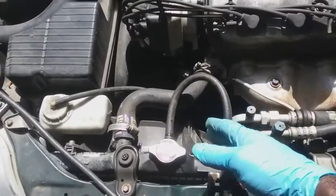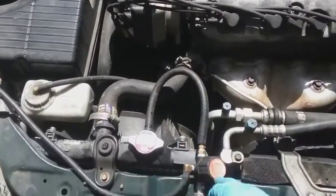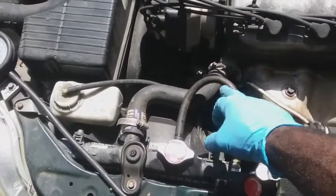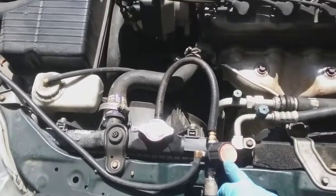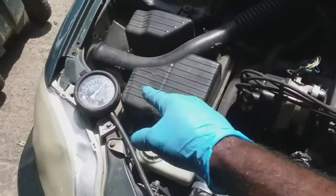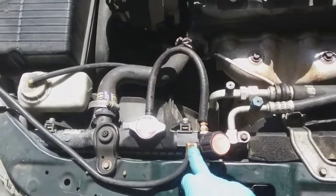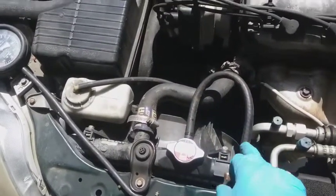I'm going to design it to be a little bit more efficient. I could probably remove this gauge and add it to the front up here, and then put a cutoff in the back so I can monitor the pressure in the system. Because when I pull the pressure off, it's only the pressure that's bleeding off the regulator — I'm not sure if it's bleeding off from here or not, but I know this cap is bad and the system is not completely sealed.